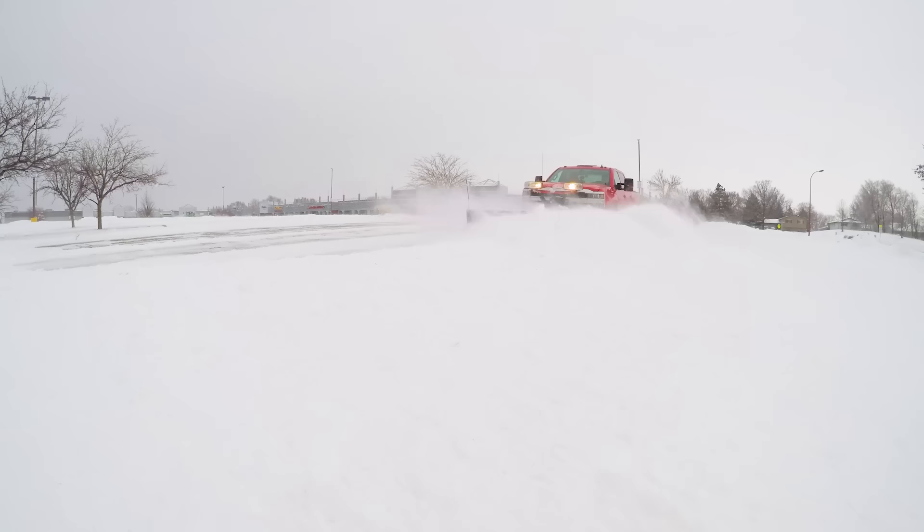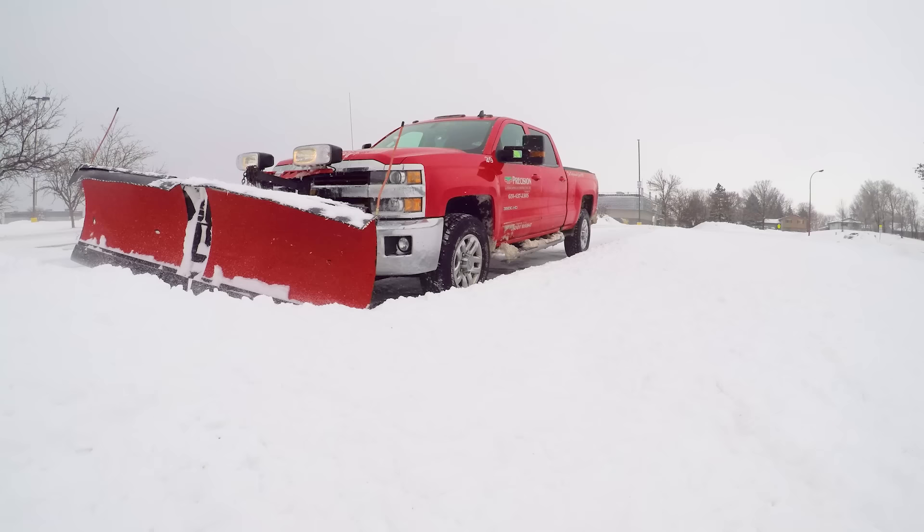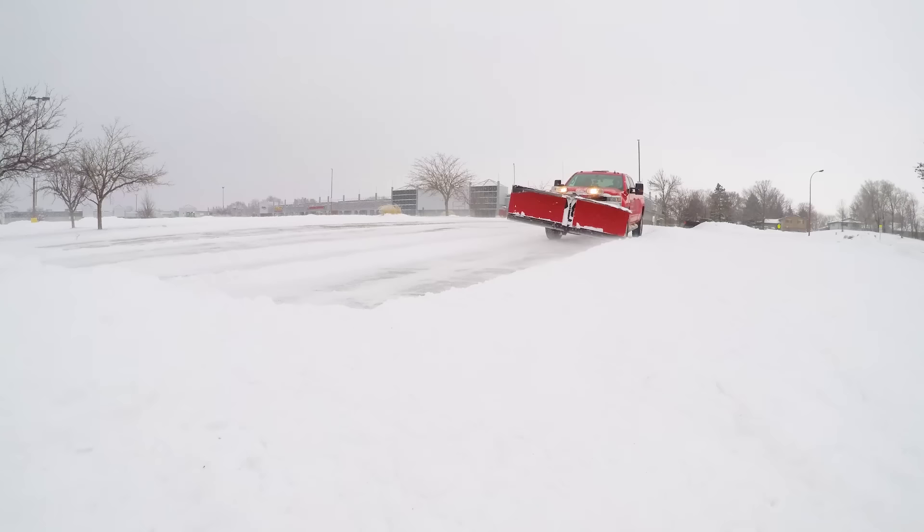Now what you're going to feel here as you push more and more snow, especially when you're windrowing, is the front end is going to want to push your machine out a little bit. The bigger the pickup, I'm not feeling that as much. We've done some other videos like with a John Deere Gator — if you have a lighter machine, you're going to feel that more, and that's where you have to counteract it by steering into it a little bit, otherwise it's going to keep pushing your front end out.